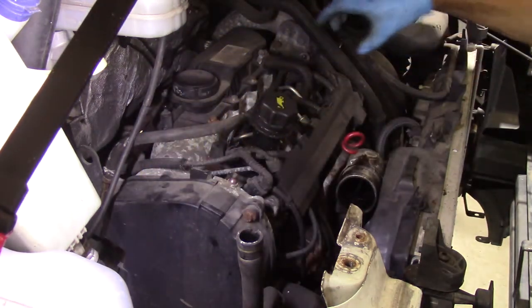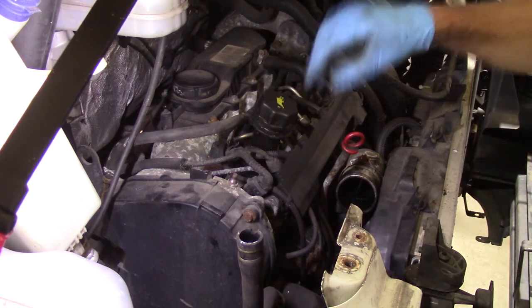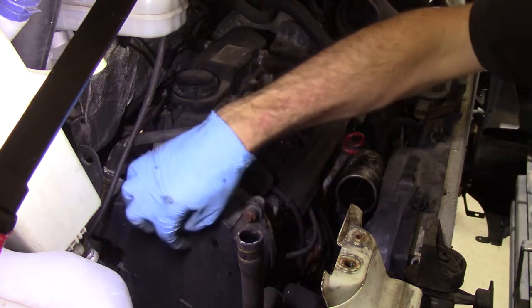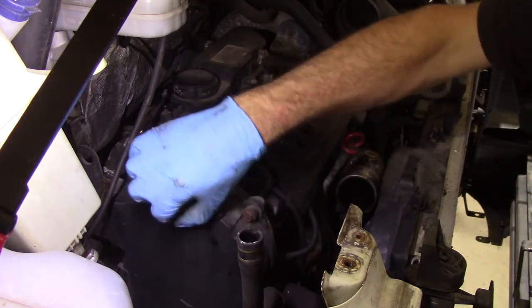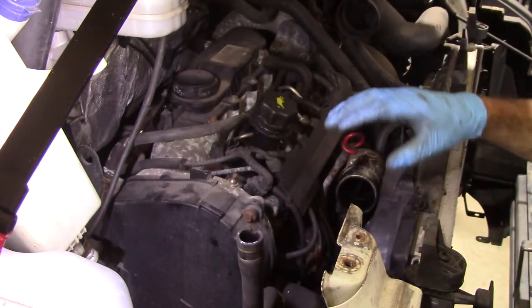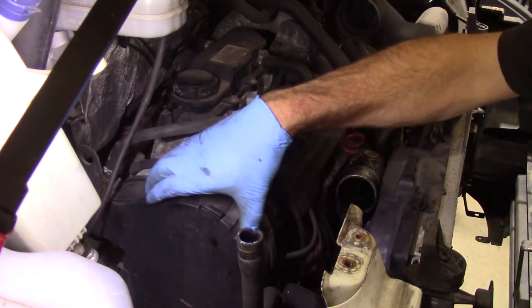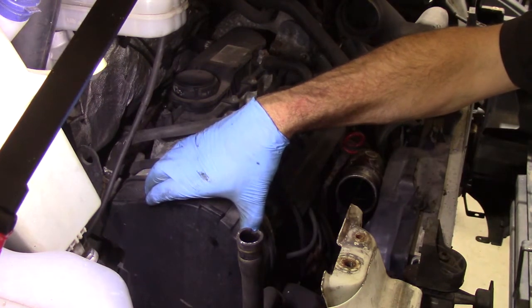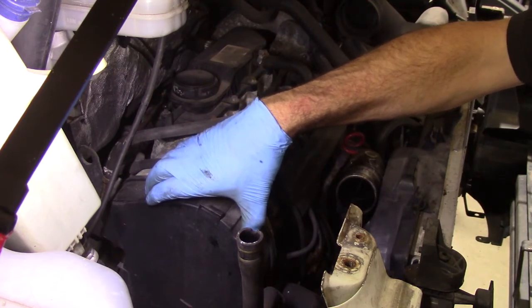So what you should do is put the pins in to lock the cams, put the pin in to lock the crank, slacken the centre nut of the cam pulley so it's free to turn, and put the locking peg in to hold it. And then when you come to put the belt back on, because you've got a bit of free movement on that pulley, it's supposed to make it a bit easier to put the belt on and more accurate in getting the timing correct.